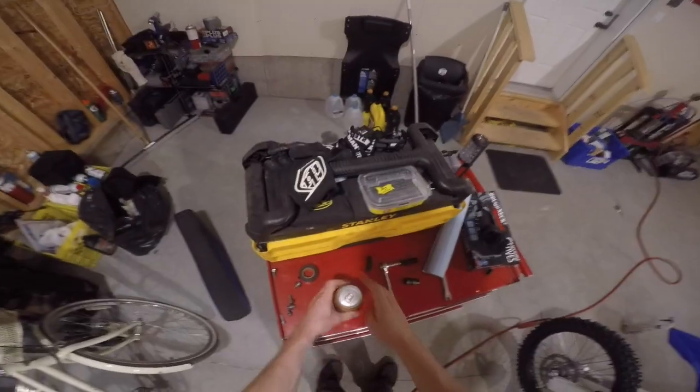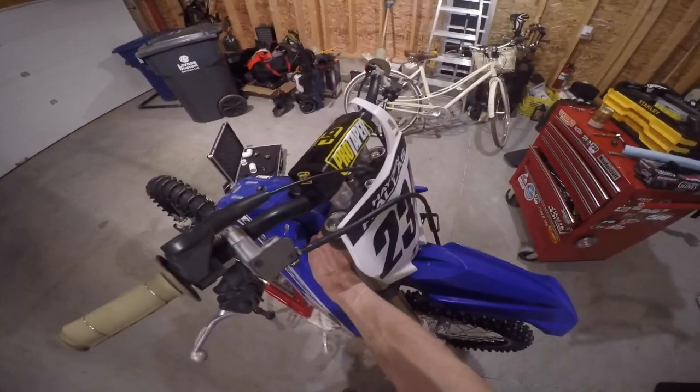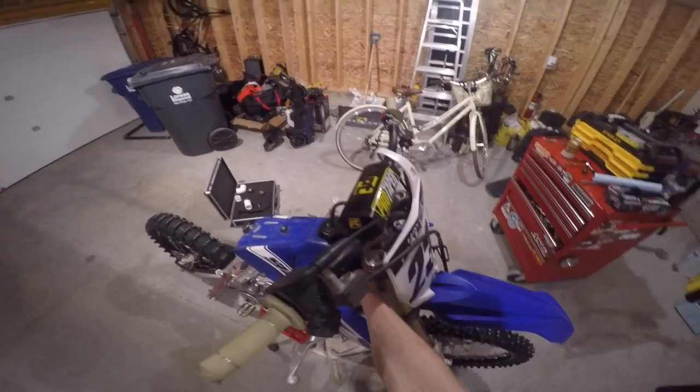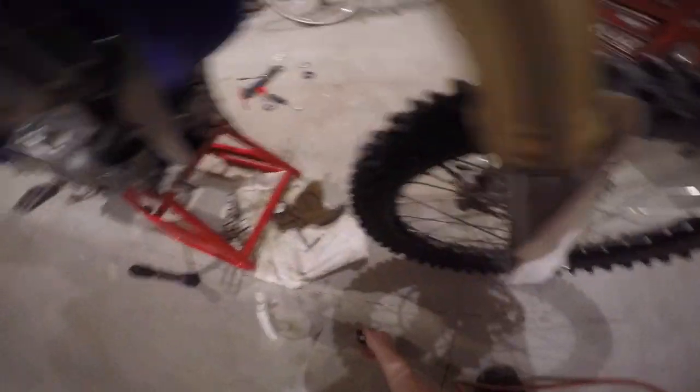Before we get going it's best to crack open another one — my ears work better when I'm a little buzzed anyway. Before we even get started putting air into it, take off the radiator cap in case there's that bad of a leak that you pressurize your whole entire cooling system. You don't want to blow anything up there, so take that off.